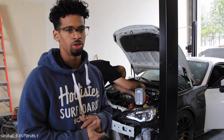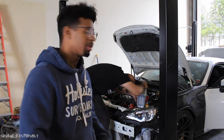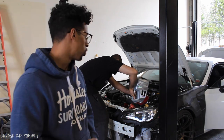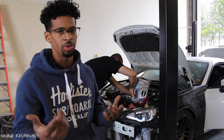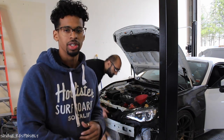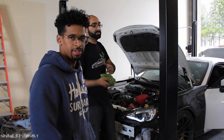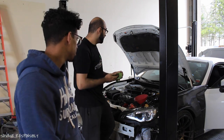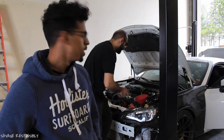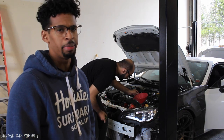Just to make sure there are no leaks or anything like that. Z put in five quarts to start, he's gonna put in the sixth quart now, and then we're gonna let it run for a bit. At first the car wouldn't start because we already had the four-bar MAP sensor in there. Z realized that was the issue, so he put in the stock one and the car turned right on, because the stock tune is not calibrated for that four-bar sensor — it has increased resolution. So with the stock one, it was basically sensing whether there's enough air pressure. He just put in the last quart — we're gonna turn it on again, let it run, and make sure there are no leaks.